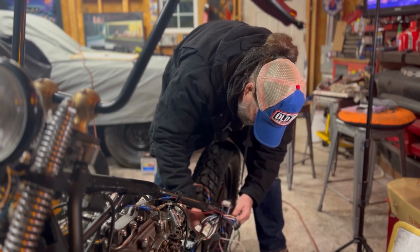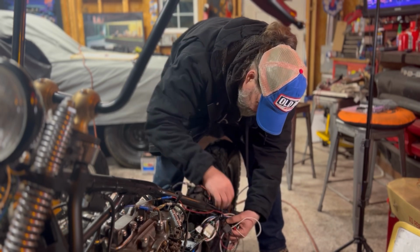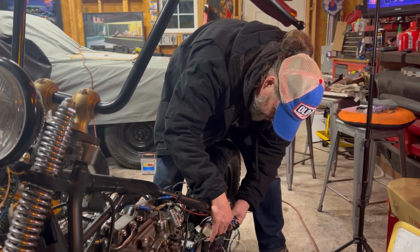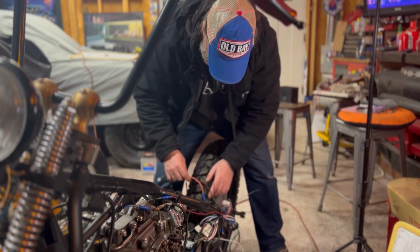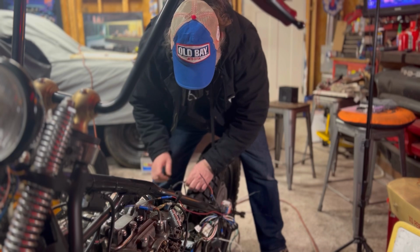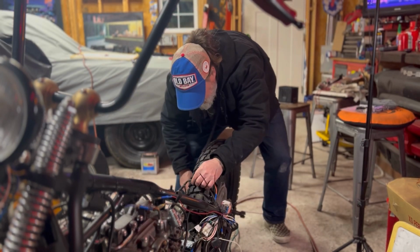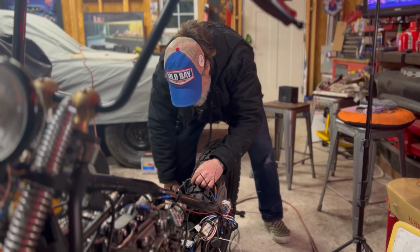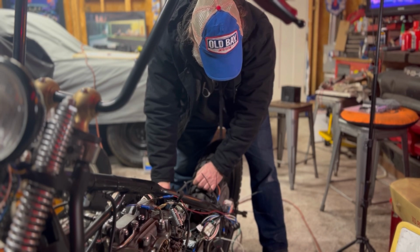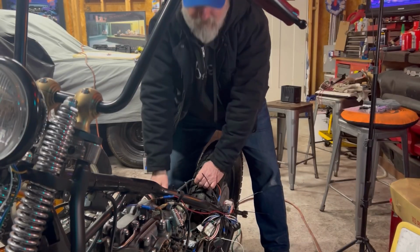Yeah, we were off by one wire. Remember, we accidentally connected and we were keeping that hot the whole time. Wasn't it a brown wire? So it's this black wire. This comes off the key and goes to the positive. Right. And then from there, that key turns on your coils, right? Makes them hot? Yeah. And that's what we had done. We left it on constant, right? Yeah, we weren't doing anything.